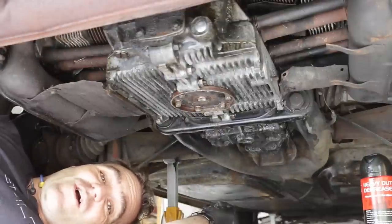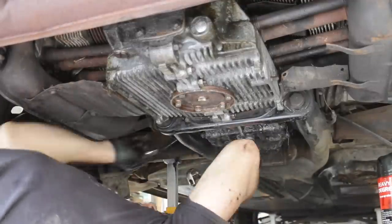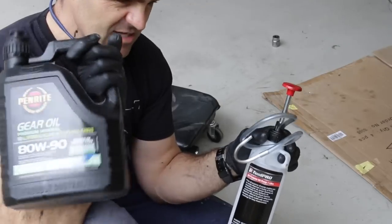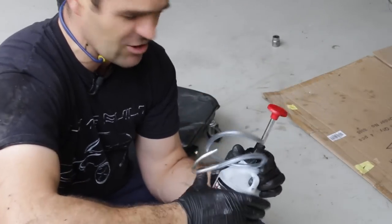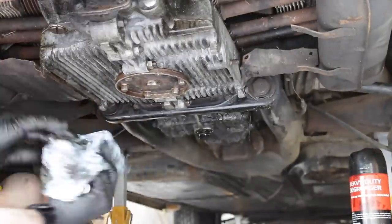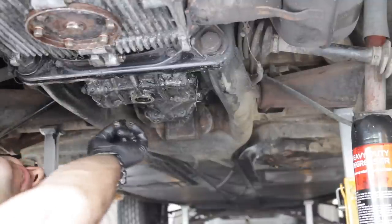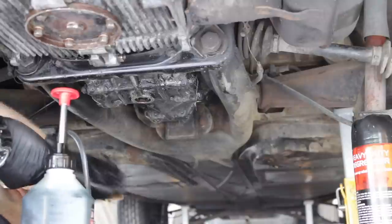I forgot to turn the microphone on again, but the next job is to drain all the oil out of the gearbox. Before I go and undo the sump plug and drain all the oil out, I want to make sure I can reach up on the side and undo the fill plug — because if I can't undo the fill plug and I've drained all the oil out, I can't get oil back in the gearbox again and I've got a car that doesn't work. To get the gearbox oil up into the hole in the side of the gearbox, I've got a little hand pump and I'll just fill the pump up with oil and start pumping it in.